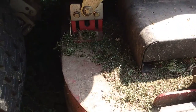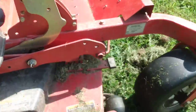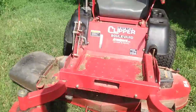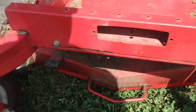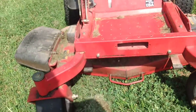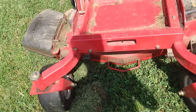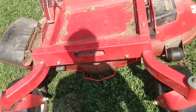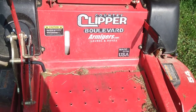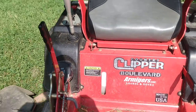As you can see on the deck, it does have a similar anti-scalp feature. Like most lawn mowers, it doesn't have chains — it just has a slider. There are two anti-scalp wheels on the front and two on the back. The issue is it's missing the front anti-scalp wheel, and as you can see, the weld is starting to come off slightly at the bottom. The anti-scalp wheel there likes to dig trenches, especially cutting at about two and three-quarters of an inch. To fabricate one and put it on would be more pain than any good. And the hand adjustment here is another minus, because you're constantly having to take your hand off the control to slightly raise the deck on a slope.